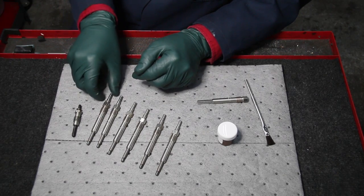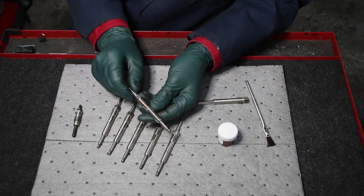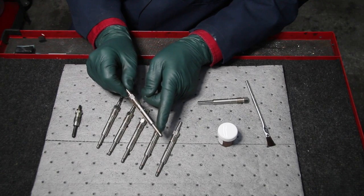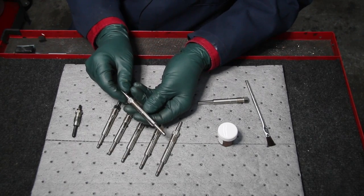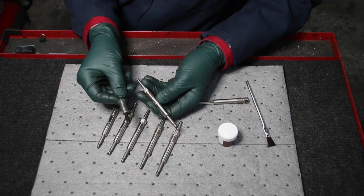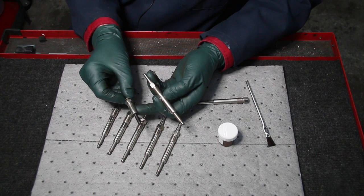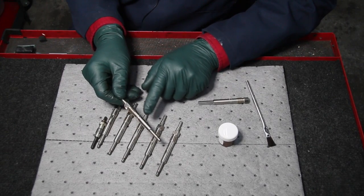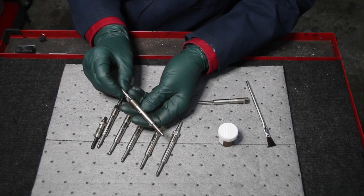Now compare that to one of the glow plugs installed in the 1995 W124 E300D six-cylinder. This was a new design on the engine — notice how they lengthened out the glow plug so it really takes a long reach down into the pre-chamber, with very similar threads where it seats inside the head. The problem with these glow plugs is two-fold: in the later 80s and early 90s they also went into aluminum heads, and any time you put a steel glow plug into an aluminum head, I highly recommend you use anti-seize. The problem is partly the length and also steel going into aluminum — that's where you have to be really careful.